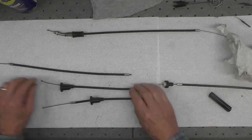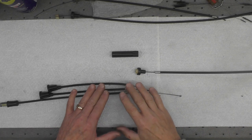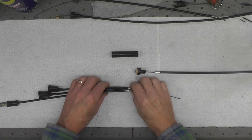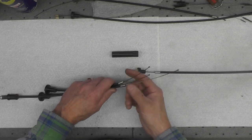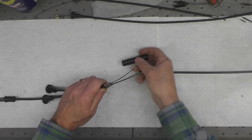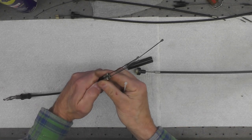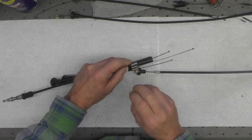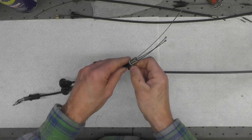This cable is the one we are going to keep, and this is the oil pump cable, so that is going to be replaced. Now that I have the assembly apart, what I am going to do next is lubricate all four of these cables — it is a little easier when everything is detached and disassembled than doing it when it is all put together with this union box. In order to lubricate them, I am going to take the three lower cables and just group them together with a zip tie.